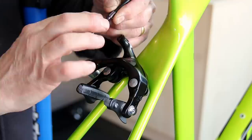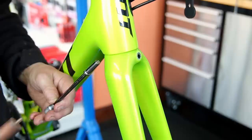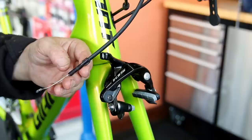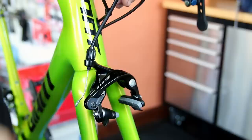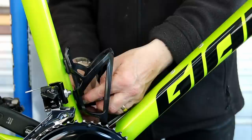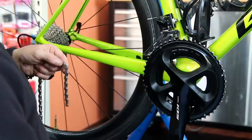On go the brakes now — chainset and derailleurs all fitted. We lubricate the thumb adjusters on the brakes because they can get sticky; since they go into a plastic mount I use general purpose grease rather than anti-seize. It makes a real difference to day-to-day adjustability. Brakes are adjusted off camera — both front and rear were actuating great. For bottle cages, I put a little grease into the holes rather than on the bolt threads, so it works around the threads as we tighten up and stops them binding into the frame.